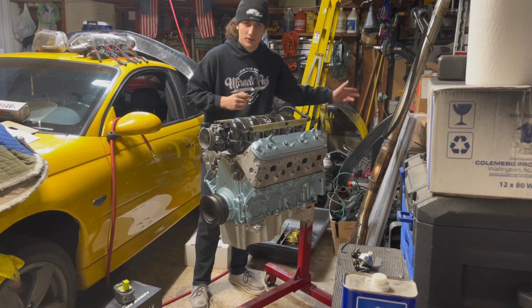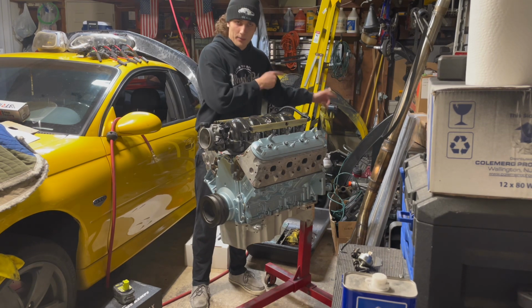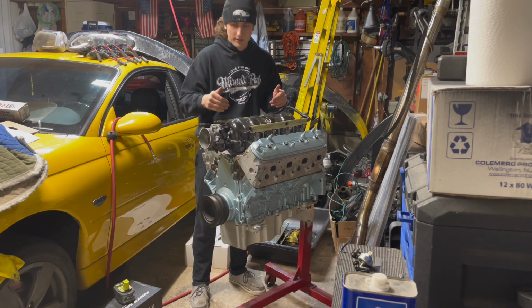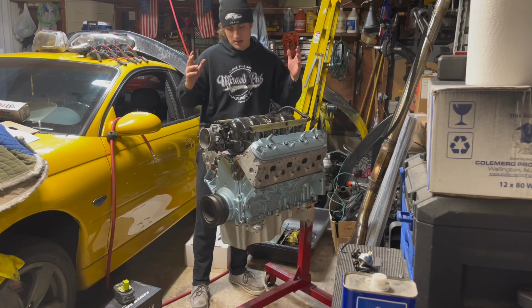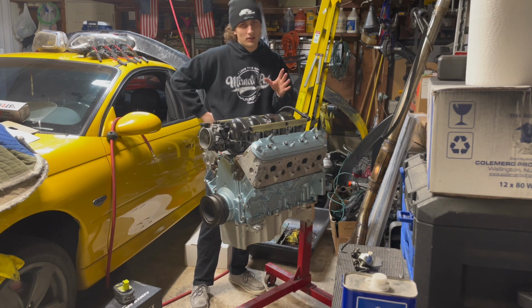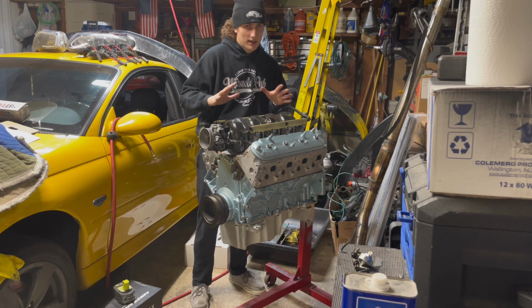Valve springs from the stock 241 LS1 heads, which were upgraded valve springs for this BTR Stage 3 cam from the previous motor. Those need to get swapped into the 799 heads. Rear main seal, again, install of everything you're looking at essentially. So there's still quite a bit of work to be done, but we're going to try to knock that out in the next video.